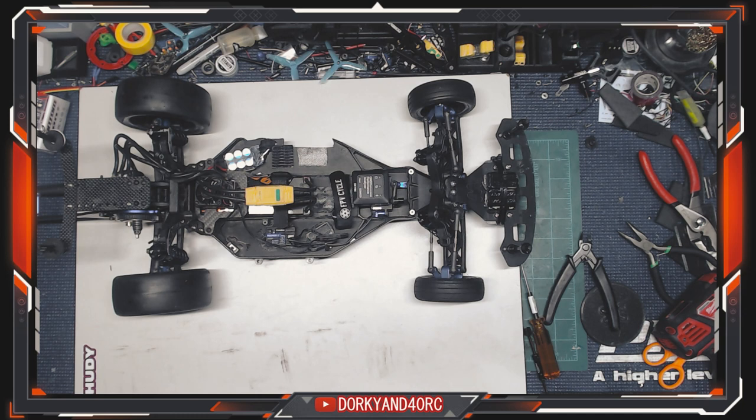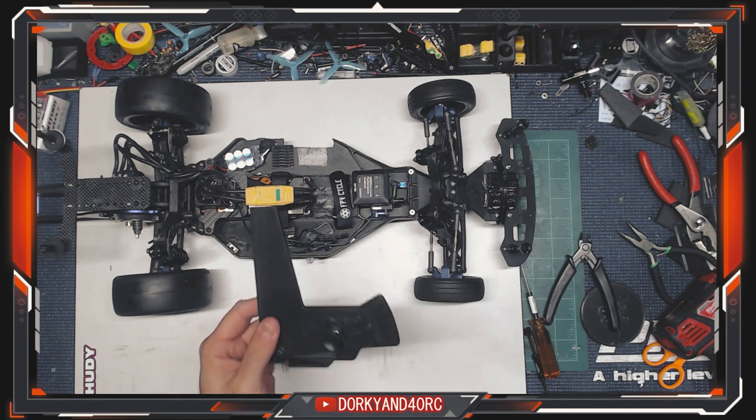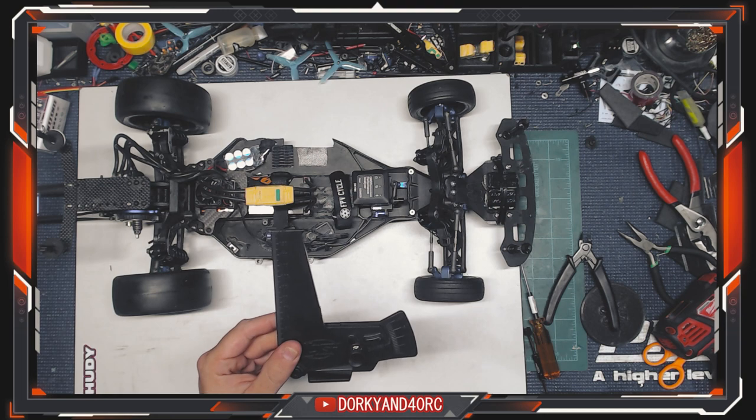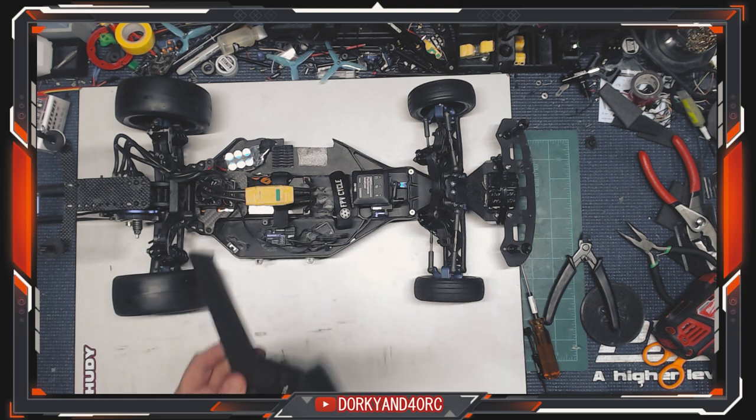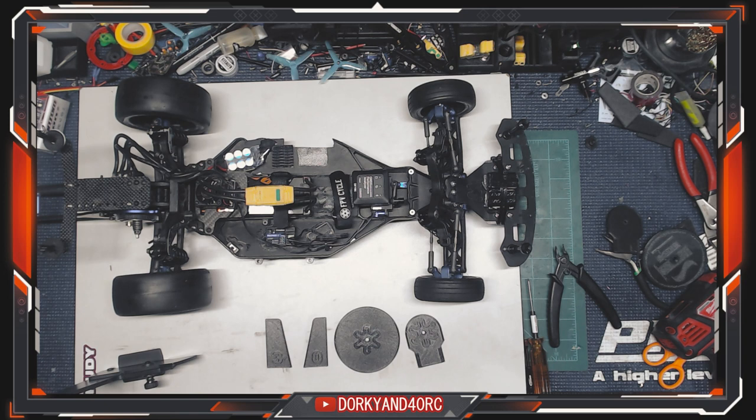To get my measurements correct, we're going to be using a couple things. The first is a Low-C camber bar that you can get pretty much at any hobby shop online or anywhere else. And then to work on our toe, we're going to be using a big carpenter square and a toe gauge setup created by Tim over at Barth Racing Concepts. You can find this on his Etsy store — I will put a link to it — and we'll show you how this all bolts up and helps you get your toe.